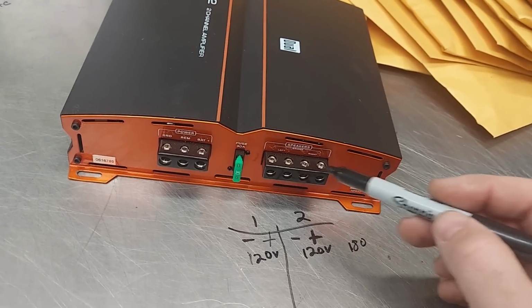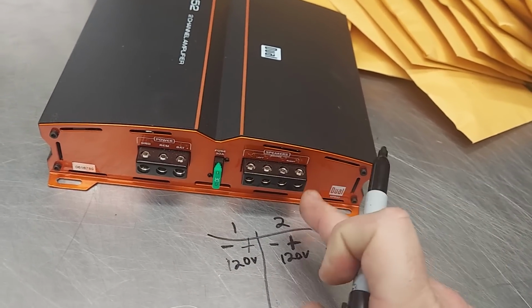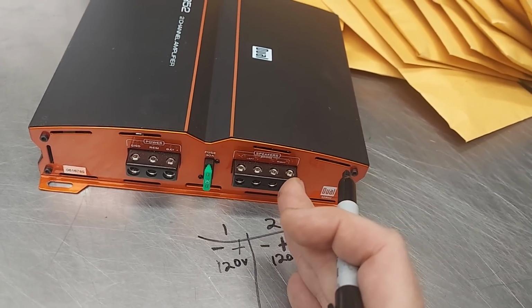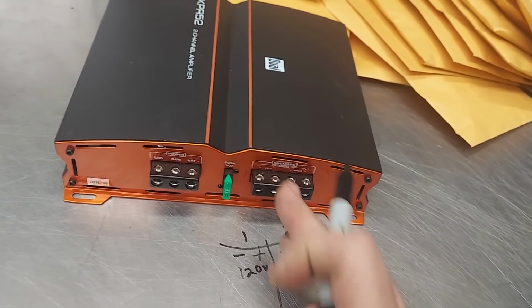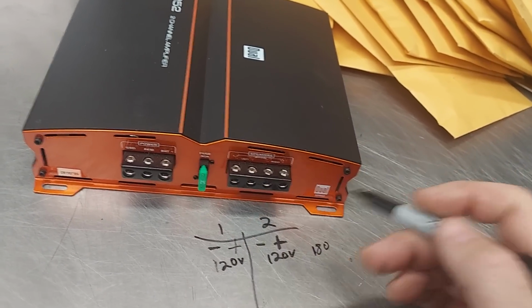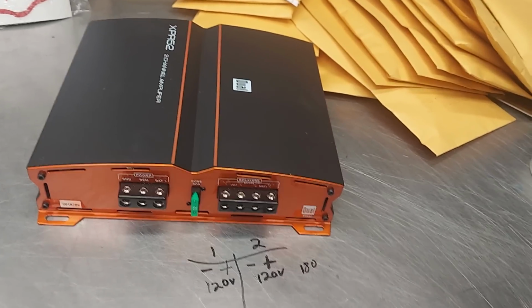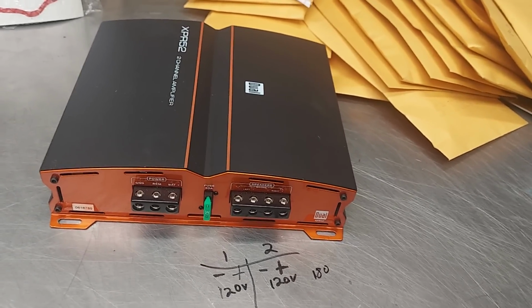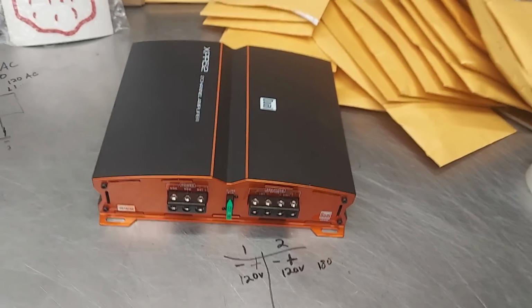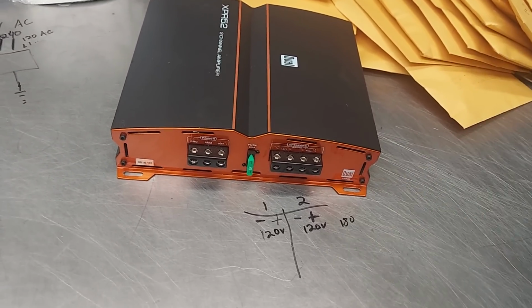That's what bridging is. So this one has 220 volts, just like your wall panel right there. There's 220, but it also has 110 here, 110 here. And usually what they do on a circuit panel is they'll run this side, this leg, this half of the circuit breaker box to one half of the house, and the other half to the other half of the house, because you don't want any problems where you're touching the stove and the fridge and one is on each leg and you shock yourself, okay? The reason they do that is because in the past they've had them wired like that and people have shocked themselves. Like some ladies sitting there working on a washing machine, and we're talking about one with a wringer that you have to wring out your clothes manually, and she would get shocked. There's all kinds of stories about that kind of stuff. And usually it's told by not high school teachers, but anybody teaching you electronics about that. But that's the reason why.